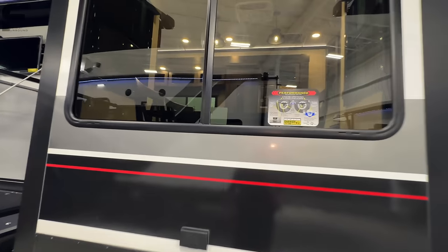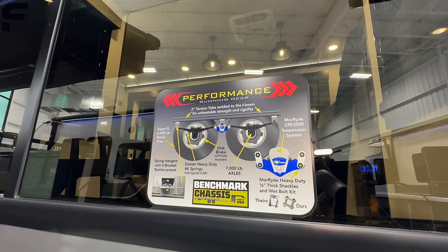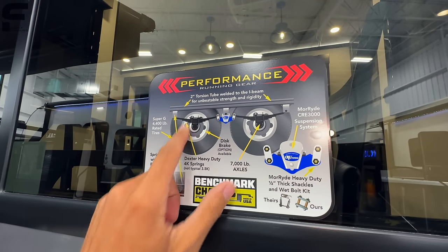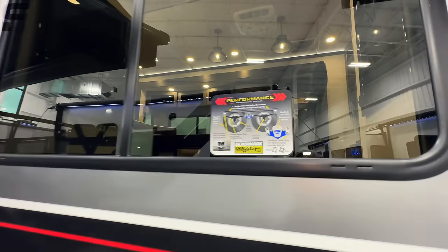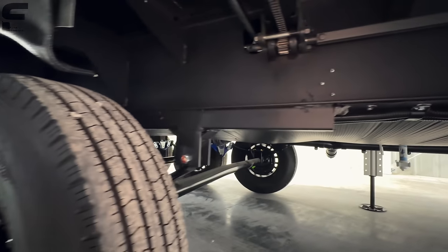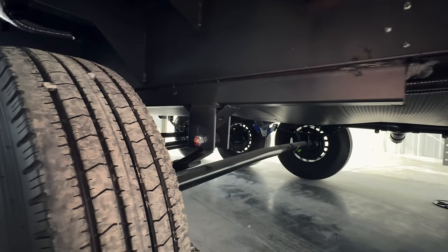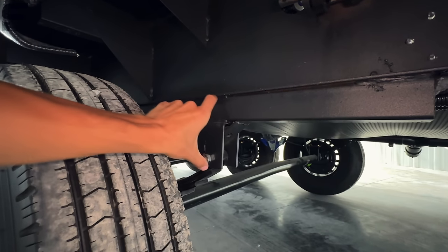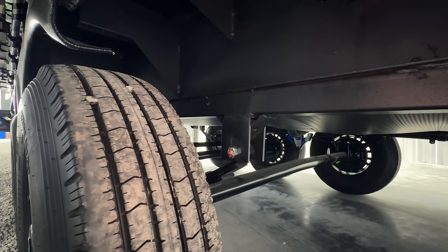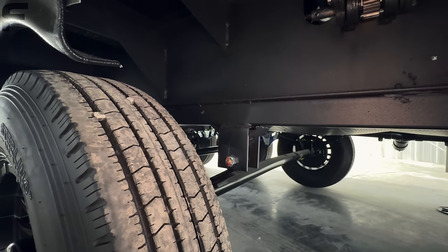And then this has the performance running gear — this is something that's really important that I'm trying to talk about more. The only optional thing on here that won't come standard is the disc brakes, but it has this two-inch torsion tube that is welded to the I-beam. That's going to give it more strength and rigidity as you're going down the road. I'll get under here and kind of show you what this looks like. You can see that two-inch beam right there that they weld to the frame, and then all of your connections for your suspension come down off of this two-inch frame. This shortens up this piece right here — the longer this is, the more force that it's going to feel as you turn and the suspension goes up and down the road. So the shorter that is, the stronger it's going to be. They also use these triangle frame connections there to give it even more backing and support.